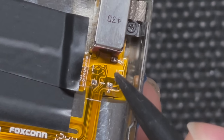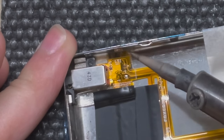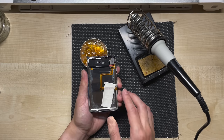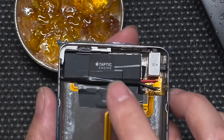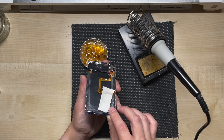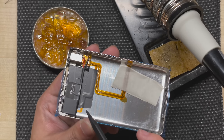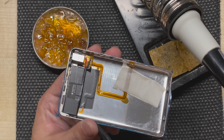We're going to wire up the Taptic Engine to these two contacts here, so we're going to trim them as well. When it comes to choosing the location for the Taptic Engine, I've placed it where the old battery used to be, because the new battery is going somewhere completely different. However, if your internal setup is different, then you might need to put your Taptic Engine somewhere else. If you're putting your Taptic Engine in the same place as the old battery, just make sure the top and left surfaces are touching the edges — that way it can carry the vibrations through much better. Previously I used super glue or double-sided tape to attach the Taptic Engine, however this time I am now using epoxy glue, which is much stronger and should give much better results. In terms of soldering, we'll be using these two pads here, and not the third one. And because the Taptic Engine uses alternating wave current, it doesn't matter which cable goes to which pad.